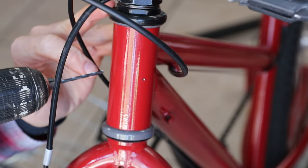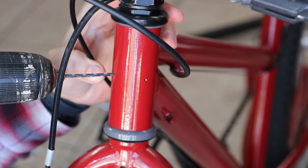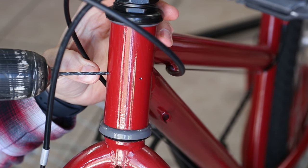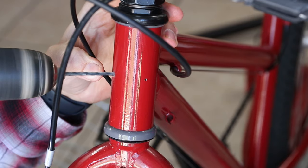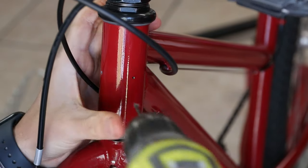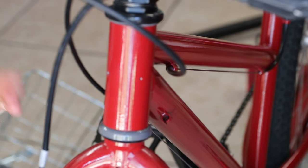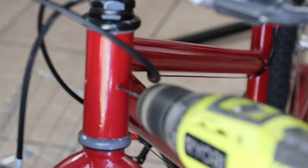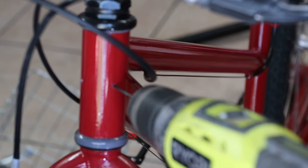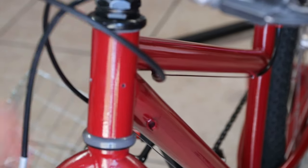I do have the right size drill and tap. It's a 6-32 tap, and this bit is in imperial units — 0.116 of an inch in diameter. Now I'm a little afraid — let me know what you guys think — is there any kind of risk of putting chips down into the bearings? I could imagine that might happen, but we're going to give it a shot. And if I feel anything weird, you know, it's a trash or bash, so it's not the end of the world.